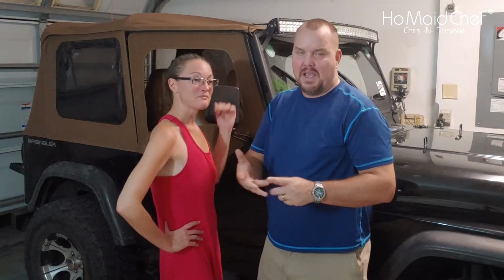Okay, so not a fuel pressure issue. We had the 30 pounds regulated, 40 pounds unregulated. And it's pretty easy to test that.